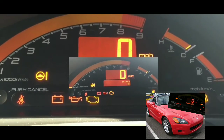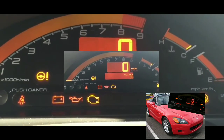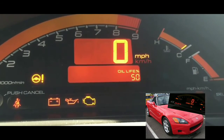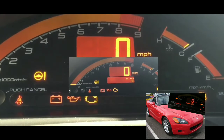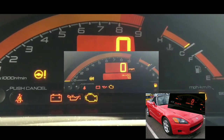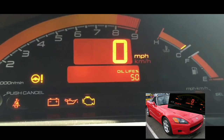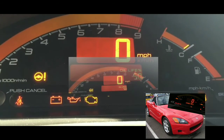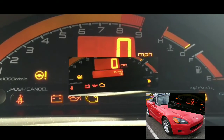Now, in a rare case, I could have had an alternator that was going out and I drove on a dead alternator all the way to my house, and the battery just died on the spot as I parked it. But here's the thing about it. I checked my headlights, and the beams are strong. My high beam is strong. I'm definitely sure it's not the alternator. It could either be an absolutely dead battery, or the starter that's just dead, which is unfortunate considering I don't think I put any more than maybe 25,000 miles on the starter before it died on me.